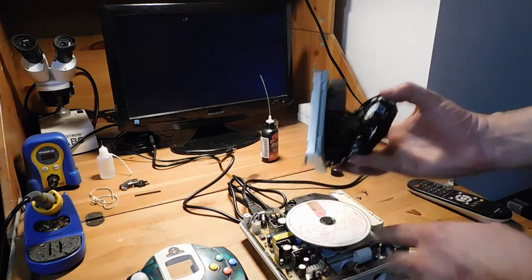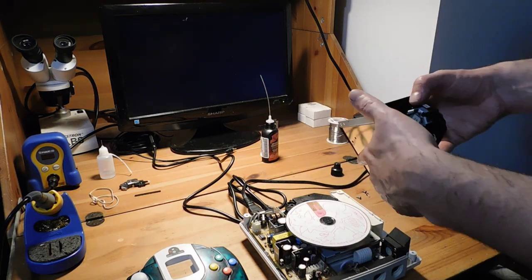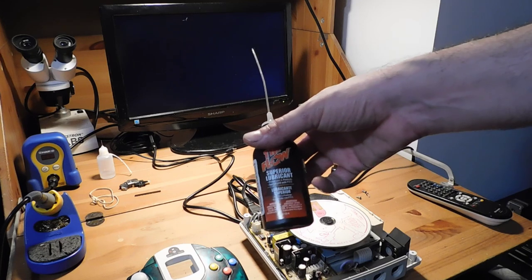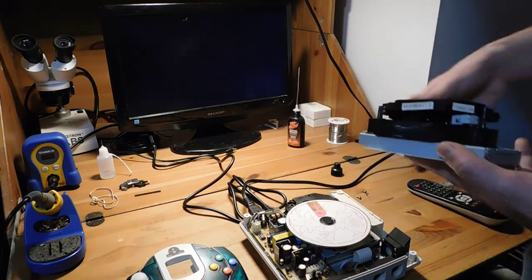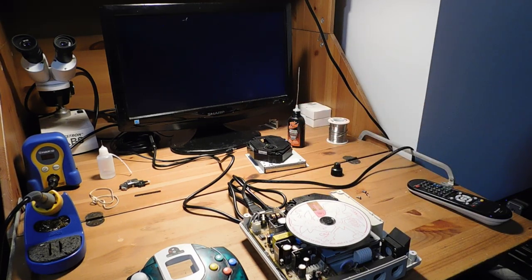And so what I did with this one, it's a totally working laser, but just as a bit of maintenance, I took some lubricant, and I'll put a link in the description for which type this is, and I just used it on the worm screw and on the gears. That's just to make sure that everything continues to move smoothly and freely and doesn't get gummed up on friction. That kind of thing can make seek times longer on disk drives and just take a little bit more time and effort to load.